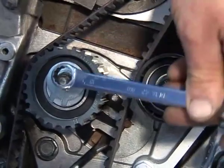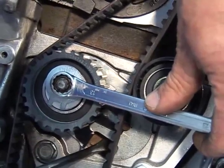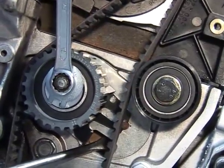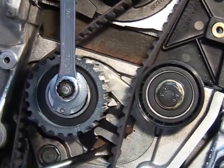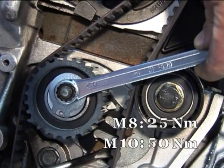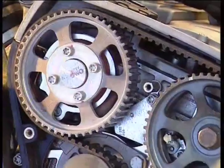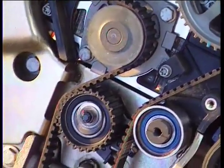Check the timing locations. Loosen the tensioner nut. Lever the tensioner bracket to align the mobile indicator and the locating notch. Tighten the nut of the belt tensioner pinion: M8 — 25 NM, M10 — 50 NM. Reassemble the other components in the reverse order of the disassembly sequence.